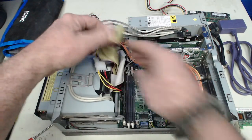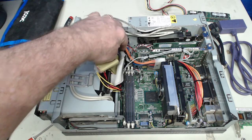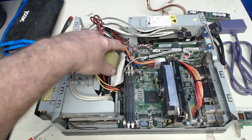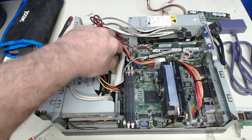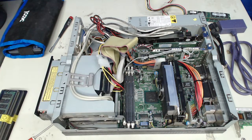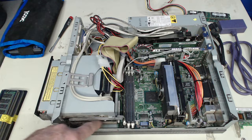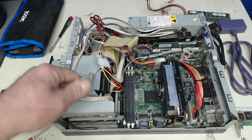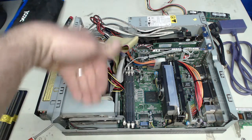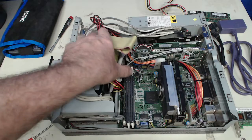I have to go through my cables. Now the hard drive cable on the other side, when you want to talk about short, it's actually folded down in here because the connection is real close to where it is for the CD cable, and the drive sits laterally here. Down in here is what would be viewed as the front, the end that has all the connections of the IDE cable being connected here. So it sits across this bay underneath just to kind of get in a nice compact position there.